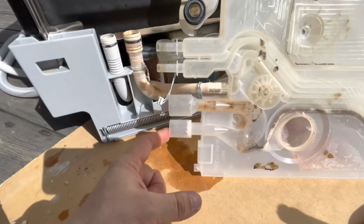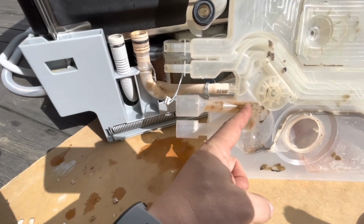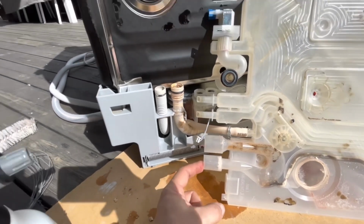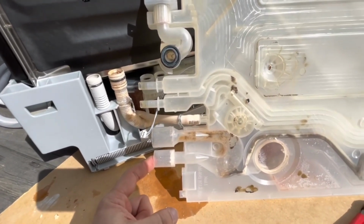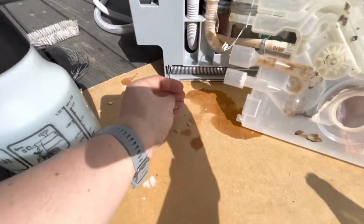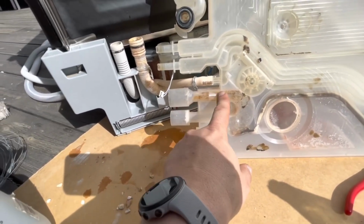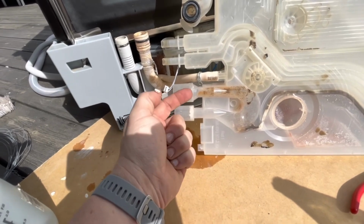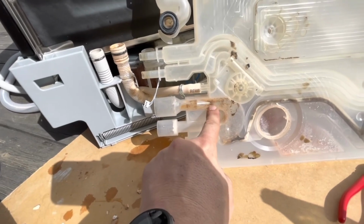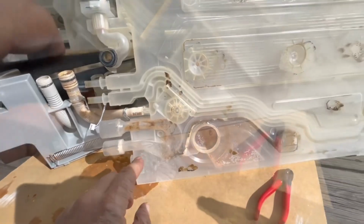As you probably saw, when I suck with an industrial vacuum cleaner through this hose, the water passes straight through and out here. And as I showed you before, when I tried to vacuum the water waste hose, nothing happened inside the machine. So I think the debris that fell out of this thing might have been the entire problem, because the water has to travel through here. When I suck through this one, the debris tightens up in this space even more and more because it's smaller here. So I think I already might have fixed the problem, but I want to clean this up anyway.